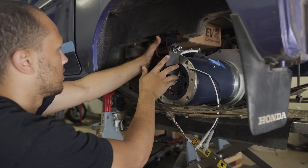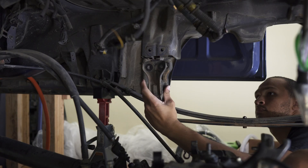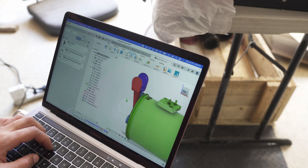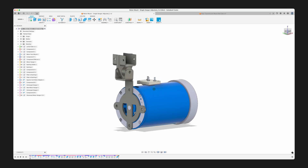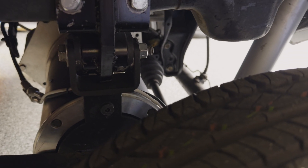After figuring out the inverter mount, it was time to figure out how to actually mount the motor and transmission. I used an LS mount to mock things up, took off the transmission mounts, took a bunch of measurements, and started redrawing them in Fusion 360 to make sure the axle angle would be correct. I actually scrapped that motor mount design — it was multiple pieces welded together, heavy, and fouled on the suspension. I ended up going with a single piece of thick bent steel that mates right up to a poly bushing — much stronger, honestly lighter, and with all the clearance needed for the rear suspension.